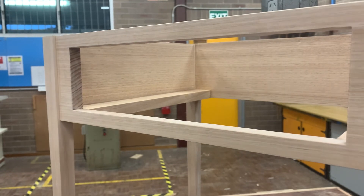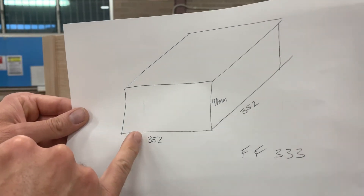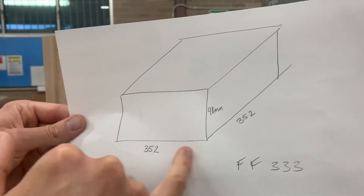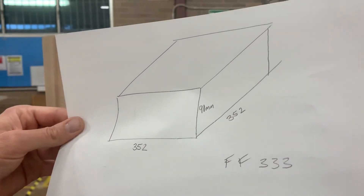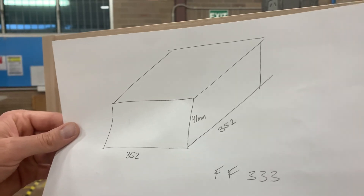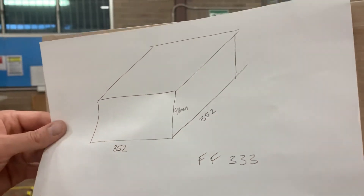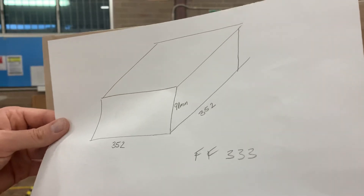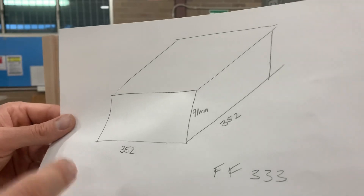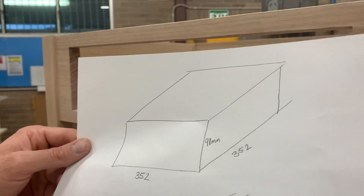After you've done that, this is what I want you to show me to confirm you're ready to make your drawer. You've got your drawing — a nice little box drawer — you've got the height of the overall drawer, the width of the overall drawer, and the length of the overall drawer. My length and width happen to be the same — that is a coincidence, it was not intentional. I also want you to give me a measurement for if you decide to make a false front, because ultimately we're going to plan to make false fronts, and if you like it with the dovetail we'll just put a packer in at the back. After you bring me this, I can prep your stock and cut it down to width for you so that you can then go ahead and cut the rest of it. I'll see you in the next video.